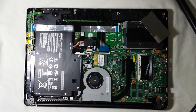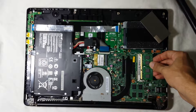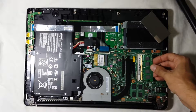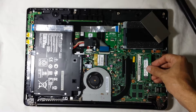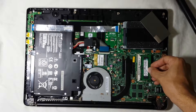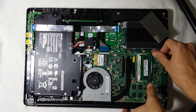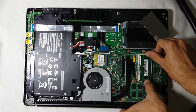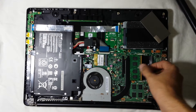The way you're going to put the RAM in is you just slide it in very gently — make sure it's oriented the right way — slide it in, and once you're sure it's down, push it down and it's locked in. To remove it, push out and it just jumps out.